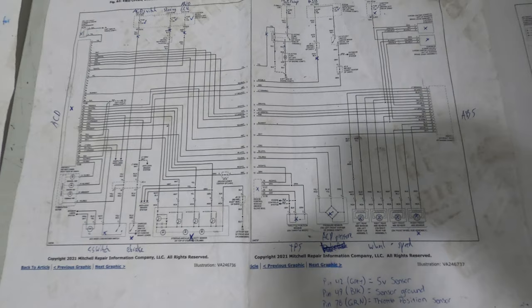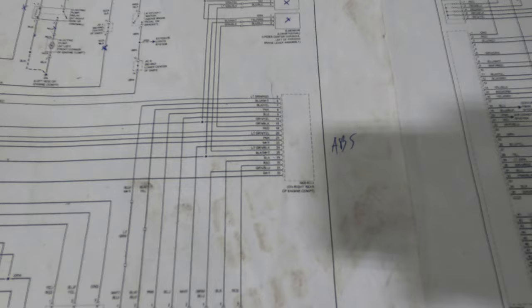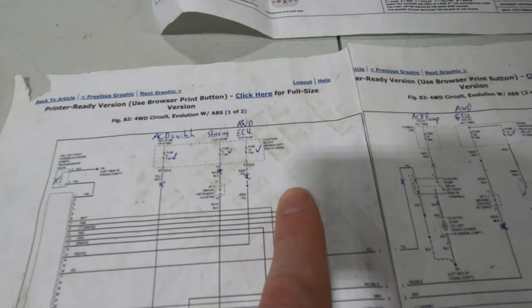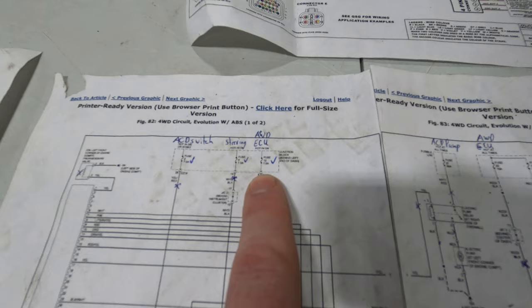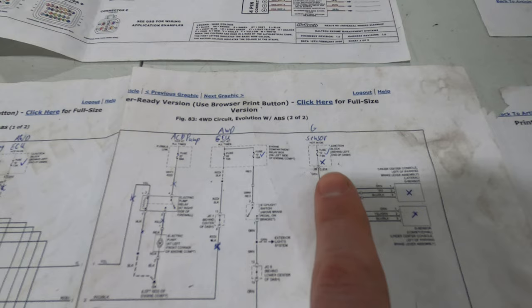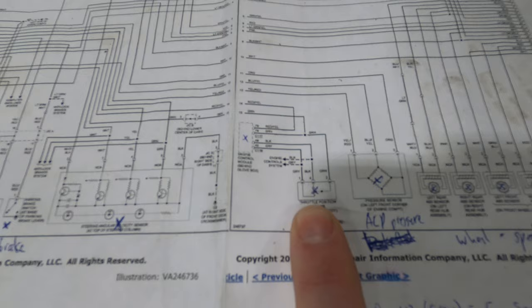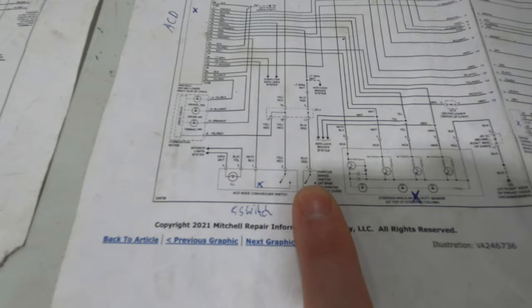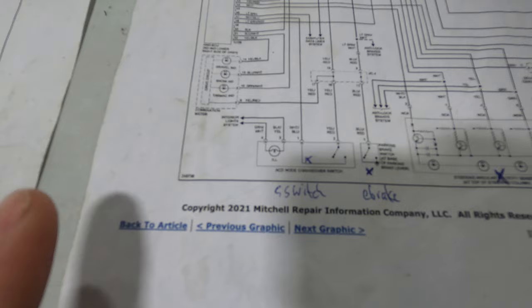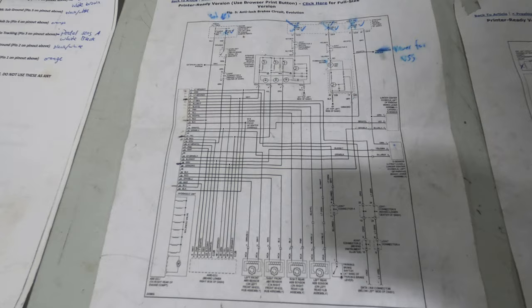This was the most difficult part of the build — the ACD and ABS wiring diagram, which I got off Mitchell Repair with a monthly subscription. On the left is the ACD ECU, on the right is the ABS, and across the top are all the fuses the stock car uses. We used 12-volt switches from the Nexus to power the ACD switch, steering angle sensor, all-wheel drive ECU, ACD pump, another output for the all-wheel drive ECU, and the G sensors. On the bottom are all the sensors: wheel speeds, pressure for the ACD pump, throttle position — you actually need to tap into the Evo 10 pedal and find the zero-to-five-volt wire — steering angle sensor, parking brake, and the ACD mode switch. We also have the three lights for gravel, snow, and tarmac wired into the dash.